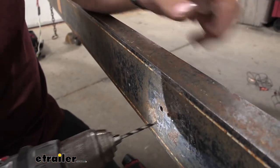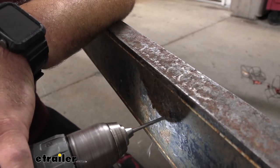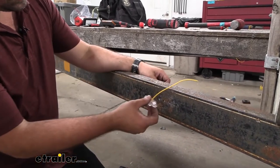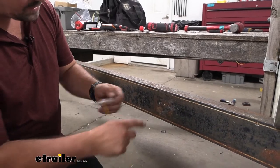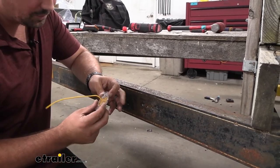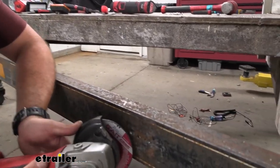Before drilling, make sure that you don't have any wiring behind there that you could potentially damage. These are really nice because they ground as you mount them to a metal frame. But we're going to want to make sure we have a really good ground, so part of that is grinding down the surface. You want to make sure it's nice and clean and smooth so we have a nice clean ground. You can use a Scotch-Brite or some sandpaper — either way that's going to work well. I'm just going to throw a quick grind on it here.